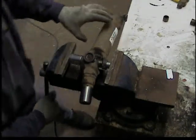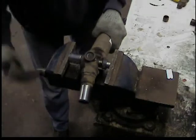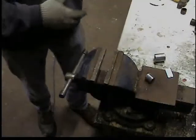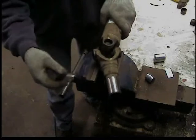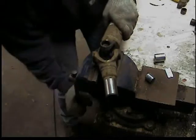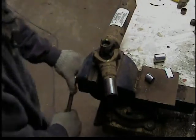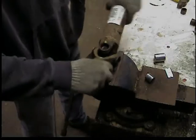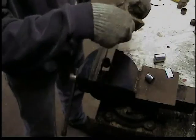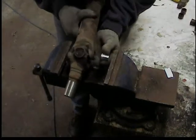Eventually it'll move over to where you're pressing the cap into the big socket. You only want to press it until the cross of the universal joint hits the cast yoke on the drive shaft — you don't want to keep driving it into that. Once it's sticking out the other side, you can pinch that cap in the vise and twist the yoke or drive shaft off that cap. A lot of times it won't just fall out if you don't get them sticking all the way out.